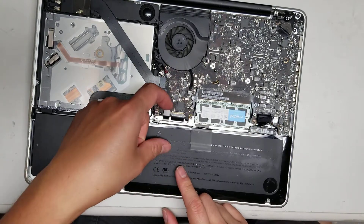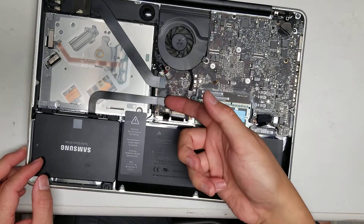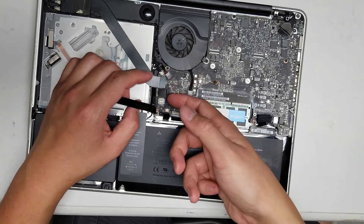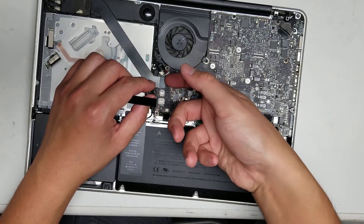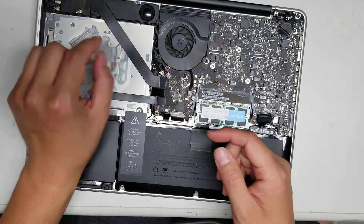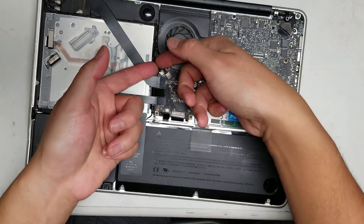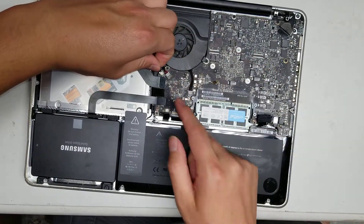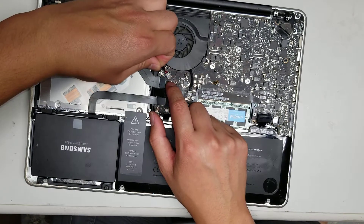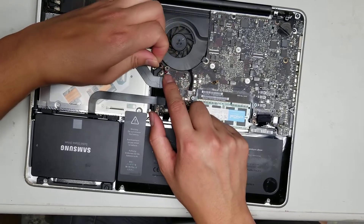This is the trackpad cable — just lift it up and take that out. I'm just going to remove what I need to in order to get the motherboard out. Take out the hard drive connector, the CD drive — or SuperDrive connector. Then you've got this for the wireless card and the speakers. Then you've got this for the camera. To pull this out, it's a little bit tricky — be very careful. You don't want to yank really hard or you can break the wire. Just wobble it side to side and it comes out.